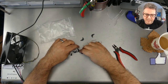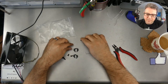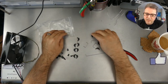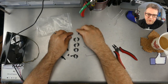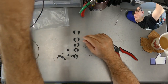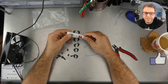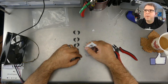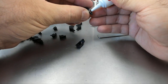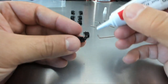The next tweak involves a little bit of lubricant, because these metal wires track along a little clipped plastic pad. So what we're going to do is just reduce the friction in there to make it a little bit smoother — these are the advantages to making your own custom keyboard. We start with a very high grade, space age lubricant called Krytox GPL205. There's a link to this in the video description. All you do is put a little bit right in this corner, because this is where the wire is going to go through.